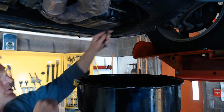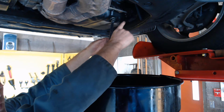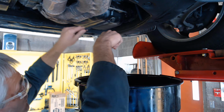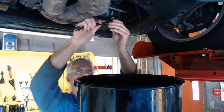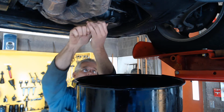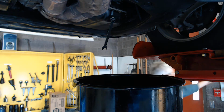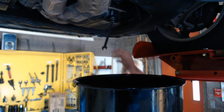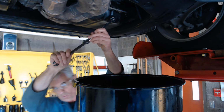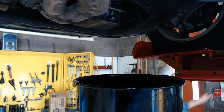So I'm going to put this 14mm wrench here, and I've got to think about clockwise is tightening, counterclockwise is loosening. So I'm going to go ahead and pull this like this in the counterclockwise direction to loosen it, and I just did loosen it. If it was too tight, I could take another wrench and put that wrench on here. This is called double wrenching, and it gives me twice the leverage to be able to open that up. I didn't need that in this case.